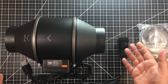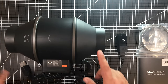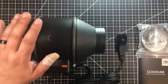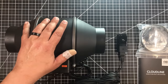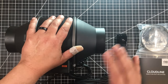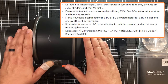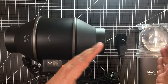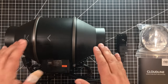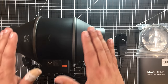You simply press this to speed it up or slow it down. It's got quite a bit of cable for the remote control so you can mount this at a distance. The power cord isn't as long as the control cable, which is fine because I had a plug placed near where this is going anyway. I'll run the control cable over by my work area so I can hit the button to turn it on and spin it up and down. This moves about 203 cubic feet per minute, which is quite adequate — whether serving the K40 laser or doing ambient extraction from the diode laser or SLA printer.